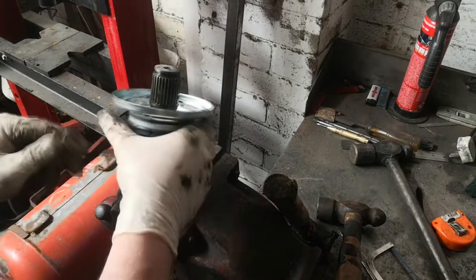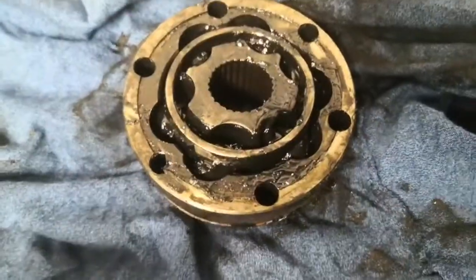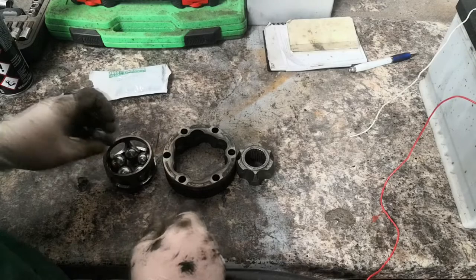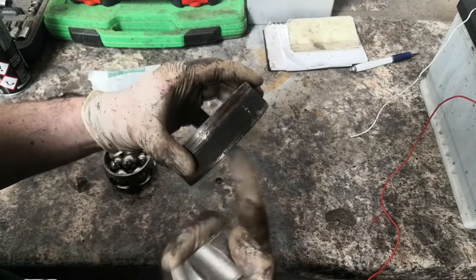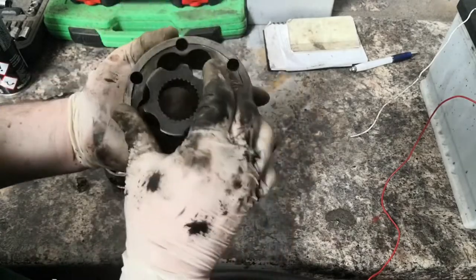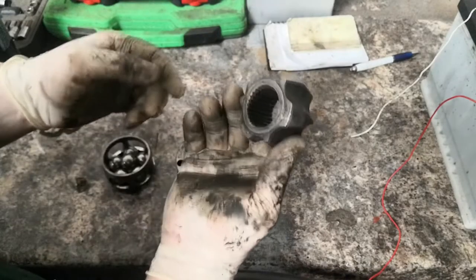The only thing you've got to consider when you put the new joint on is that these bolt holes need to line up. There's the inner CV joint — I'm going to clean it up off camera with some brake cleaner and rags and then pack it with new CV grease. So I've just finished cleaning up these parts. See how this has got a ridge and then the opposite side has also got a ridge — this is the gearbox side, this is the CV boot side. This ridge and this ridge want to be the opposite way around, so it'll sit like that once it's done. I'm going to start with putting this ridge down and this ridge up.